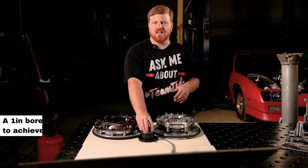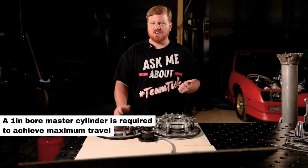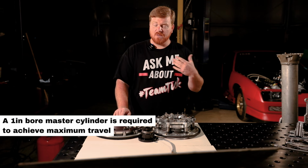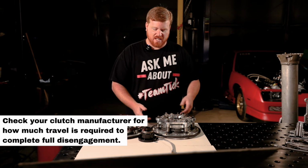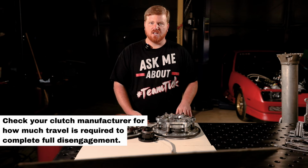This has a maximum travel distance of 750 thousandths, and you can feel free to use that entire 750. So if that means you can comfortably get 300 thousandths of gap, by all means do that. Because the more gap you have, the longer you can have this assembled in your car before you actually have to take it out and readjust your height.